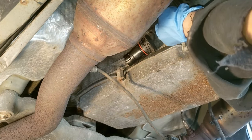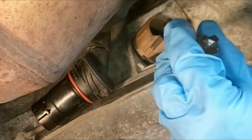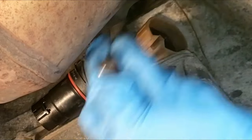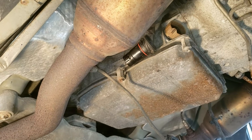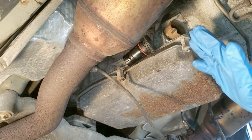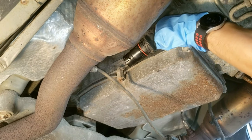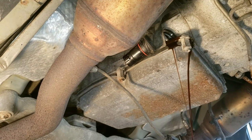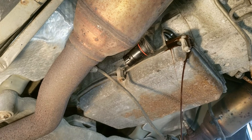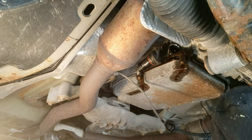Next I'll try to pull it out — the connector plug is not coming out, so just lightly pry or wedge it out with a small flathead screwdriver. Get your oil pan ready because it's just going to come out. Make sure you're wearing your gloves. I'll let some of the oil drain out, then clean this up and remove the transmission oil pan. Make sure you grab the O-ring, as it usually falls off the plug adapter when removing it.